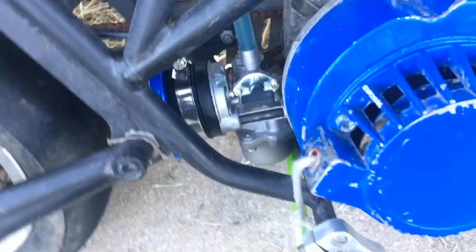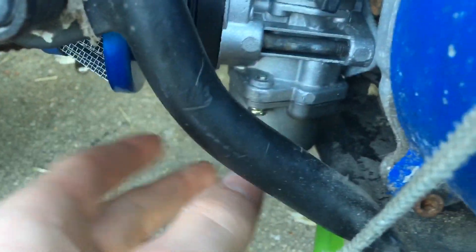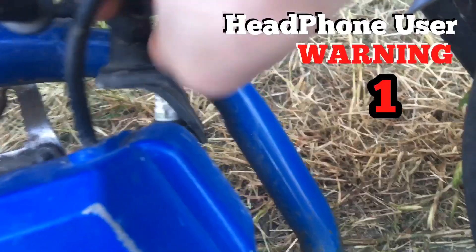Alright, that's not enough. I'm putting a little bit of fuel in just to see if it'll start. Now we're just gonna tilt the whole bike to make it go in and the whole gas should hopefully fill up. Here we go — there it is. We'll fill the fuel. Hopefully this works, we're gonna open the petcock. Now all the fuel should drain out — there we go, it's all inside the carburetor now. So let's give it some pulls. Let's put on the spark plug cap — we're about to see if this thing starts up.